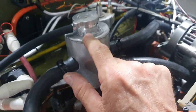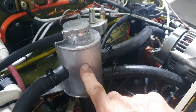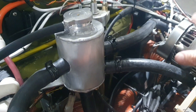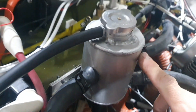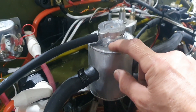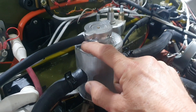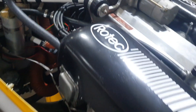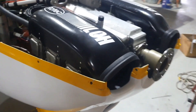I'm also happy with the reduced-size header tank — I reckon that's a keeper. It doesn't need to be a long cylinder like I've used on others, even though that holds more capacity. The reason we used this smaller header tank is because we didn't have enough room across here with the alternator and everything in the way. I reckon we'd use that design on others. I've just welded a bracket on the back of it — very convenient for mounting. We've also got a welded radiator cap base, which is a standard item you can buy, just welded on.